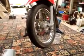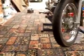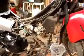The leg shields are off now. I did take out the two big bolts at the bottom part, but there are apparently two more screws at the front which I should have taken off first. As it happens, because I've got the ground clearance and where the bike is on the stand, I was able to slide it off as one piece. So don't forget to take those two screws out. The engine's all accessible now — I'll be able to do the tappets and everything later on when it's cooled, because it's still warm from running it to get the oil out.